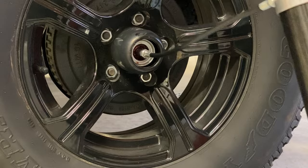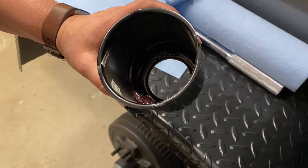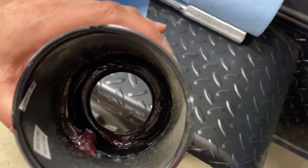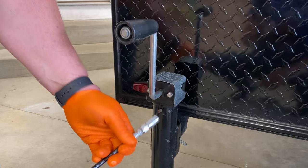I'm going to spin the wheel while I'm pumping the grease in. You can do it with the wheel on, but the thing you've got to be careful about is it's a little more messy — you're going to get more of that grease on the inside of the cap. We greased it with the wheel on and with the wheel off, and you can see if you do it with the wheel on you're probably going to have extra grease caught inside the hub. You also risk scratching the outside ring when taking the cap off. I recommend doing it with the wheel off just for that reason.